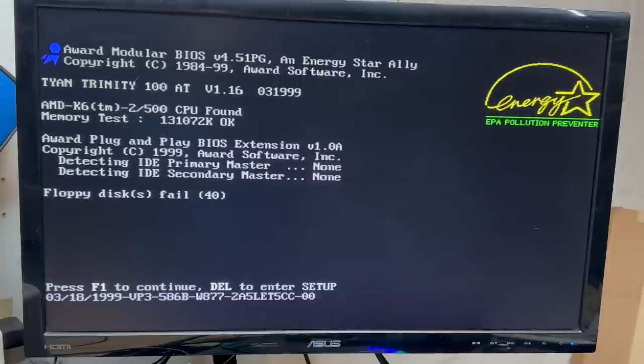These are pretty reasonable complaints, so let's get the drives reconnected. Got all the drives and keyboard connected. Power on. Hard drive sounds decently healthy. Got a floppy drive seek. I don't know what it's booting, but it's booting something — doesn't look like it's getting far. If this thing has Novell NetWare on it, I have no clue what to do with it; I have never messed with NetWare. I've given this thing a more than generous amount of time to figure its life out, so let's try a DOS boot disk.